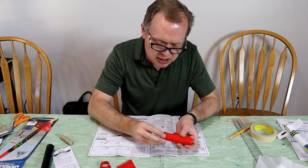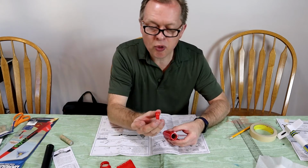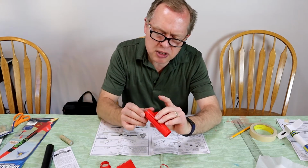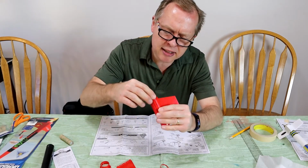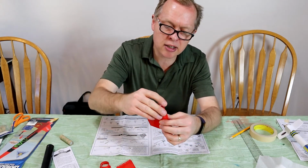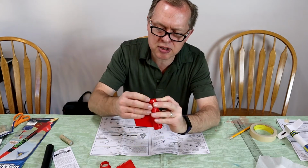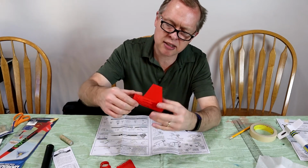These rings, this one slides over and all the way down. I'll put the back one on first because the wider of the two has a little orientation tab on it, and that has a place on the back side of the motor housing here, and that needs to go into that. So we slide that up and into that, so that that's on there now. So that's holding these two together. On the other side, we just slide this on and slide it all the way down, making sure that it's still aligned. It's got to come past a couple of little retention fingers on both sides. And we've got that past there, and we slide that down.